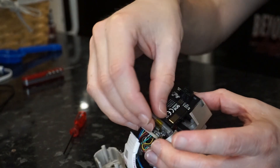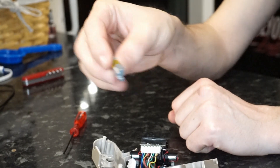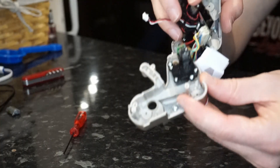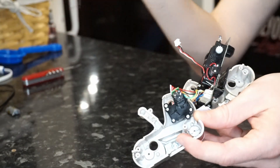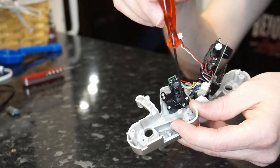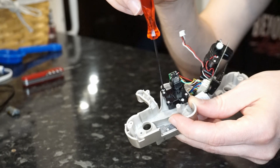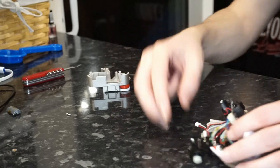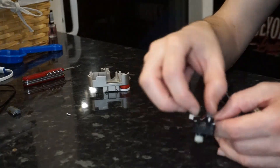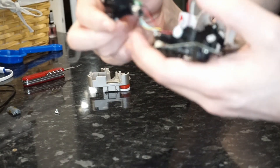As you do this, watch out for the small metal counterweight that sits in the back end of the robot, just covering the battery terminals. That counterweight allows the robot to lift his cubes without tipping over and to pop wheelies and stuff like that. Here is the gearbox assembly for the arms — we need to free this up from the body. There are two large Phillips head screws holding it in place; unscrew them and it releases from the side of the body. You can see it's connected to the main board by a series of leads and cables.